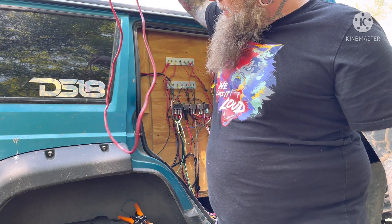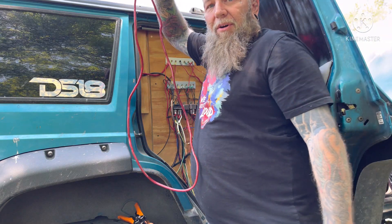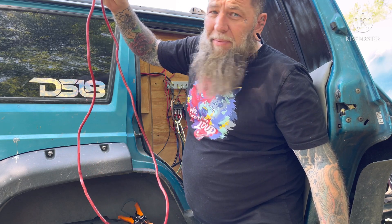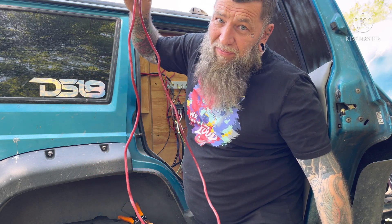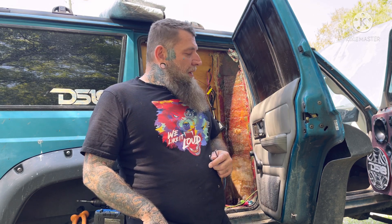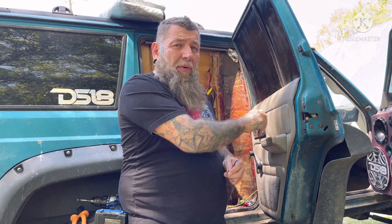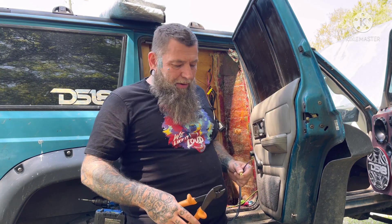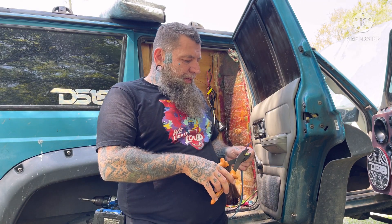Since we're going a couple feet, I went 2-gauge size bigger. Just a little bit bigger. I'm just throwing that out there so I can't be called an idiot if this thing doesn't work properly. Before I started today, my Jeep had sat a couple days and drops a couple tenths on voltage. So I drove around the block a couple times to get my voltage up to around 15.8, which is a good starting point. I only want to charge around 16.2-ish.